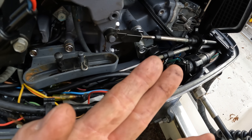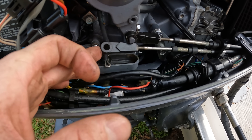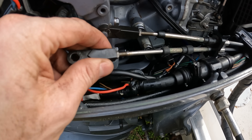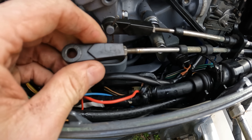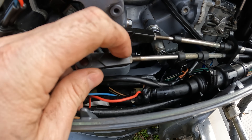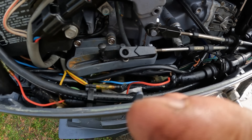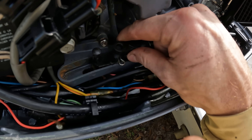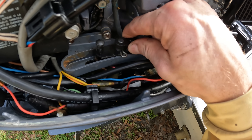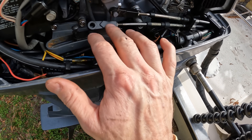It can be a little bit off, especially as things get older. And again, this is a mechanical cable shift, so it doesn't need to be perfect. But this is our shift cable. You can adjust this shift cable by undoing that nut and this will either go in and out — this little end right here will go in and out on that cable in order to adjust it. You want to adjust it with it in this locking mechanism so that it will just slide on and off easily with those two lined up. And that's pretty much how you adjust your shift cable.